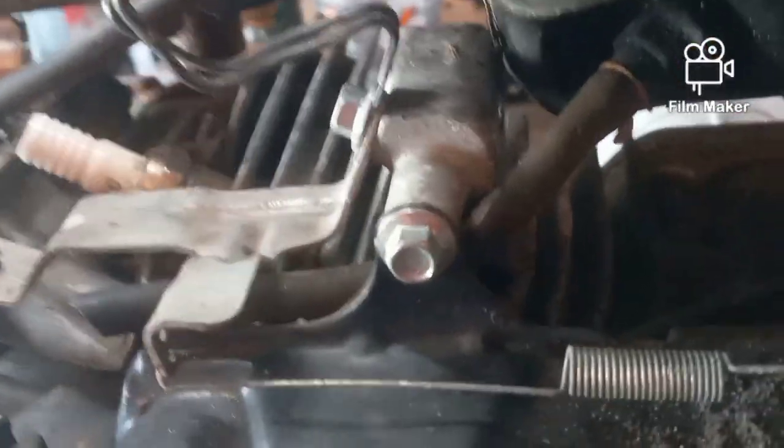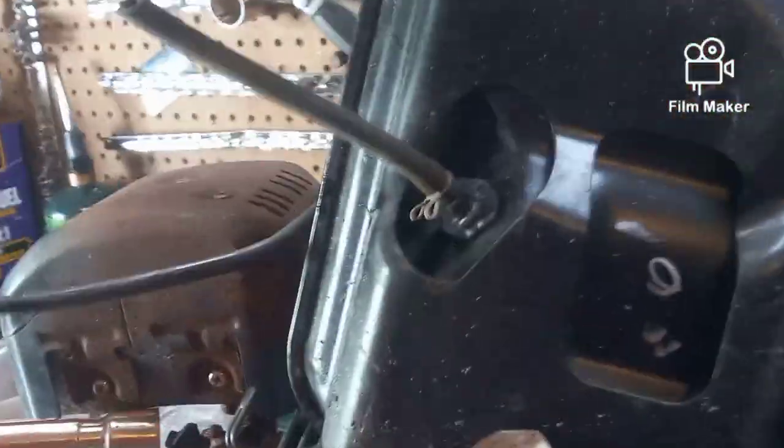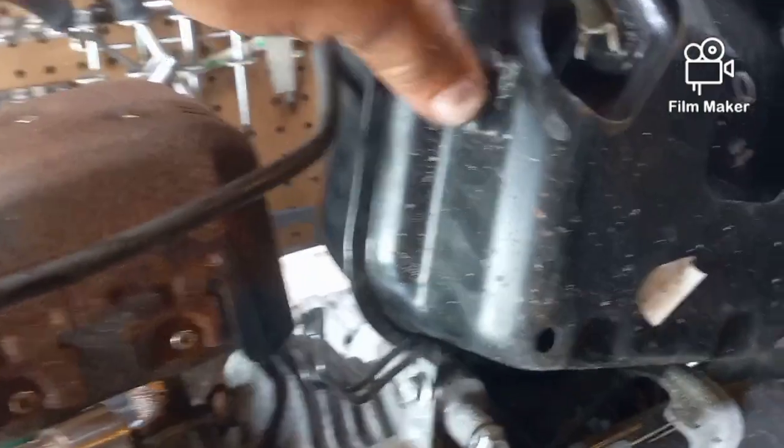And then you just have to feed, vice grips on there, you just have to pull the fuel line out. It goes underneath of there, feeds through to go to your carburetor. So I should pull the whole thing off. Now I can replace the fuel line, and you can see the post there and there that the nut went on, and that's where the bolt went through.